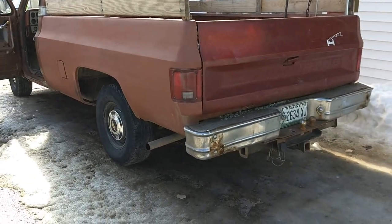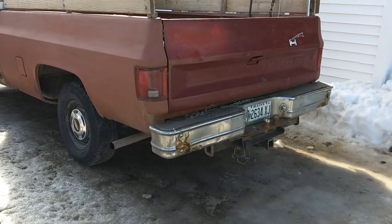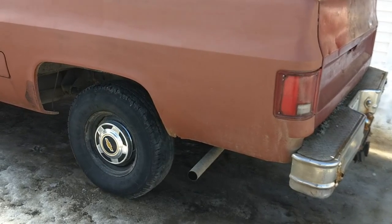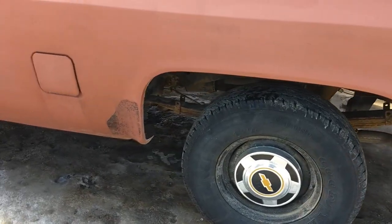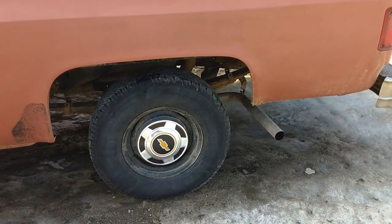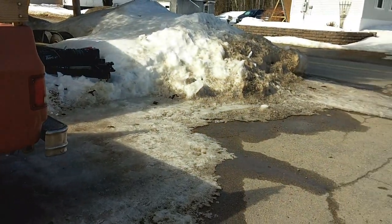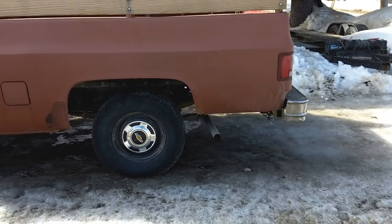I think I can just put in a 10 bolt, because I've had tons of those, and those are fine rear ends for doing pretty much anything. The 12 bolt only has a slightly bigger pinion in it, so a little more heavy duty, but not really necessary. A 10 bolt out of a Suburban, Chevy van, or Chevy pickup should be pretty easy to find, you would think, but not up here in Maine. Not many around.